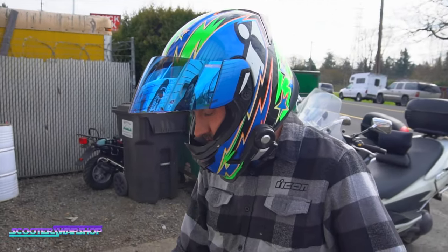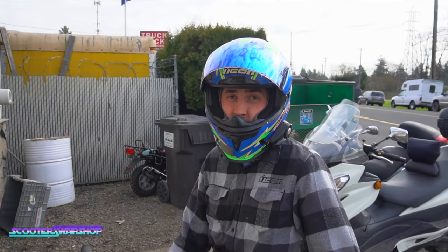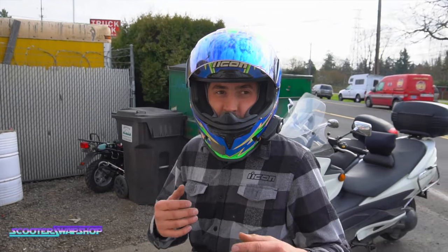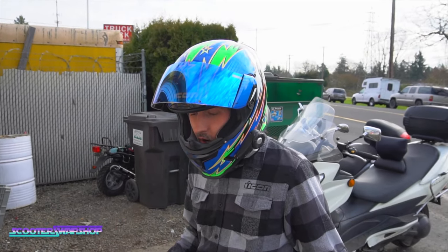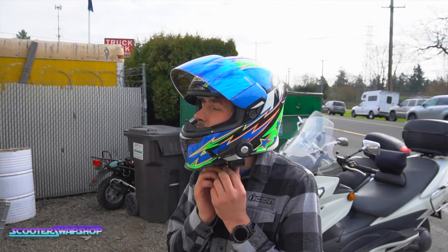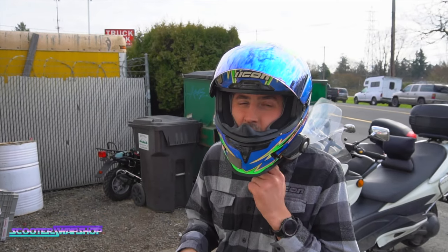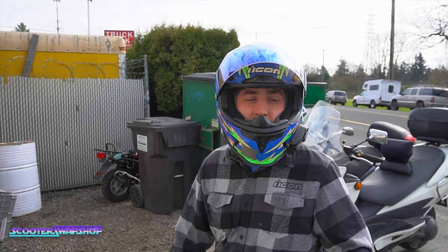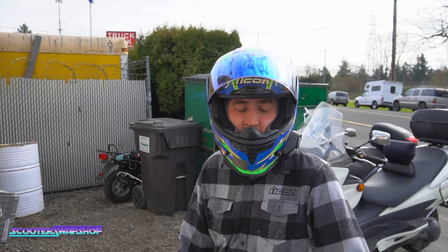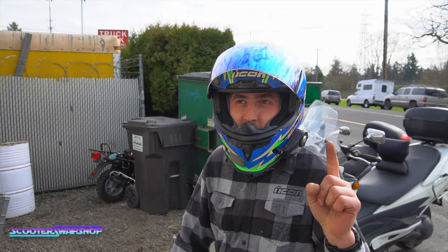I'm gonna go a little bit up in fuel, but it's pretty close. Feels good. How's it sound? Really good. I got it to like 360, so it's a little bit lean on the pilot still, so I'll probably go up one size on the pilot and then up a couple sizes on the main. He's gonna have to tweak the jets any way you slice it because he's in California. It's gonna be leaner here because it's colder. So it's probably pretty dang close.